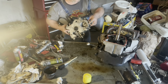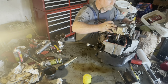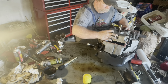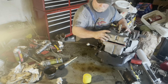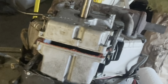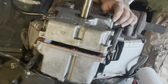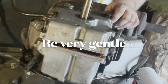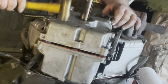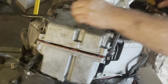Let's go ahead and get this put in place. Let's get everything lined up, get our gears meshed, and start sliding it into place. We're going to get our brass tap hammer and start tapping it down until it falls in. You want to be gentle with it, because if you go too fast, the faster you go, the more chance you have of rolling your seal. If you roll your seal and damage it, you might as well start all over.